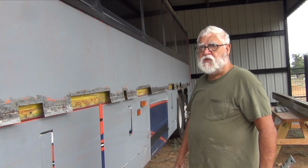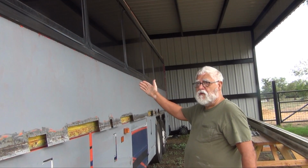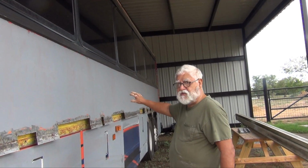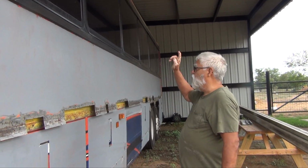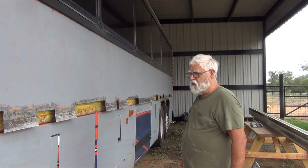There's a lot of rain. You go back there in that back section, move everything forward, and drop some plastic from that side to this side, so that we can sandblast with glass beads and see if we can take all that rust out of there. Put some primer on it so it doesn't rust out.